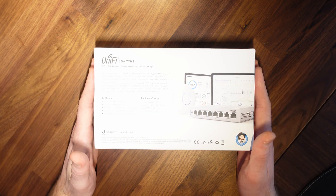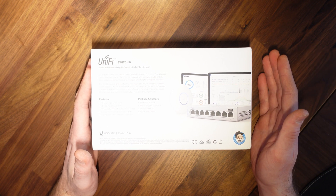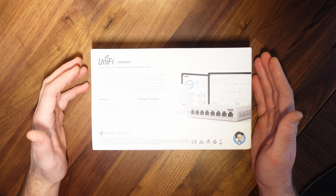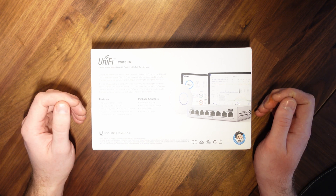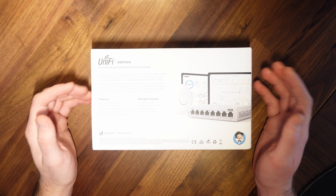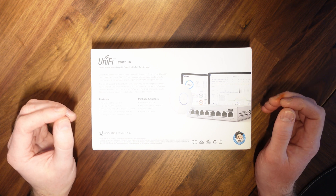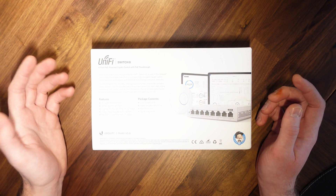That's really good — unlike my Netgear GS108 switches. One of the main reasons I decided to go with the Ubiquiti UniFi range was because all their switches are non-blocking, so you can guarantee each port will provide up to 1 gigabit per second transfer speed. Cheaper consumer switches may only have 1 gigabit per second total, shared across all ports currently in use.